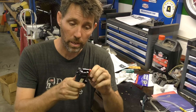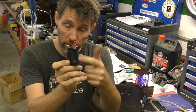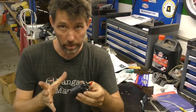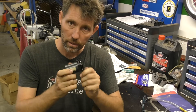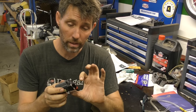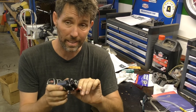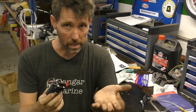You can override that by going into a start position by turning this valve away from the body of the solenoid, in which case fuel will flow in and out permanently. This means even if the solenoid isn't working you can manually turn it, start the boat, then shift it into run position. You might also be in a situation where the carburetors have blocked up and you can leave it running like this — it might be enough to get you home.